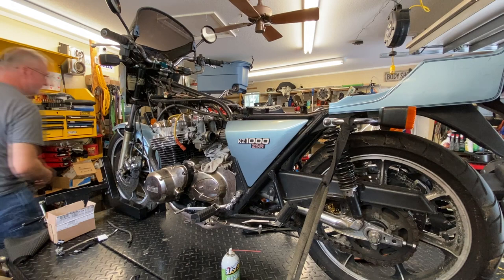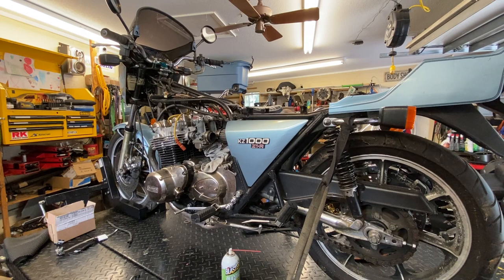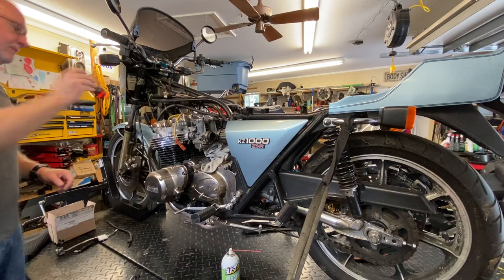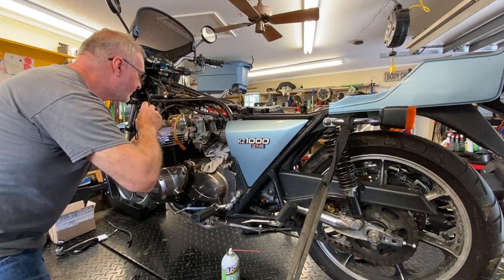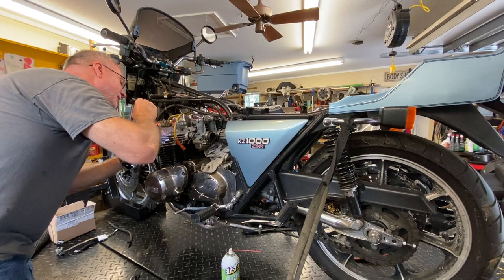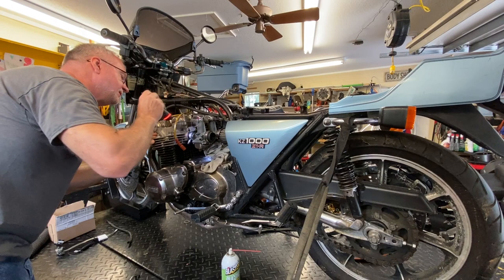Spark plug hole. Well, I can see the exhaust valve for number one opened up because it's sitting in the open position. It doesn't look bad at all. The top of the cylinder looks about nominal. Top of the piston, rather, pardon me. Top of the piston looks pretty much carboned up like it would with modified carbs, jetted, things like that. They're very often not jetted correctly.